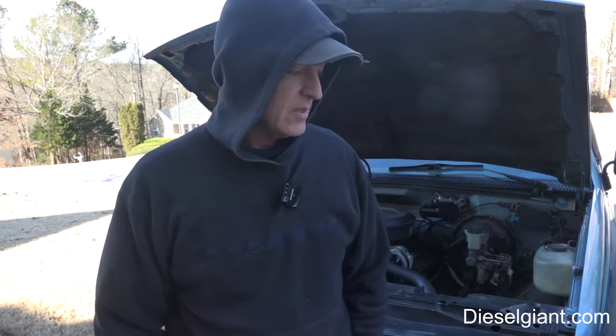Now, whoever had this truck before me never changed the power steering fluid. So that's part of the problem: when you don't do that, you get a lot of wear in the gearbox itself. You can go back and look at a couple videos I did, where I showed you how to flush the power steering system and how to install a power steering filter. That combined with good maintenance and the new gearbox will probably last as long as the truck is still on the road.